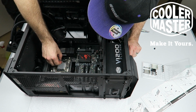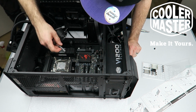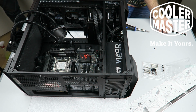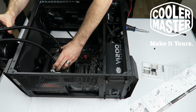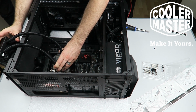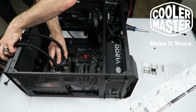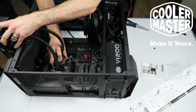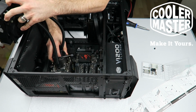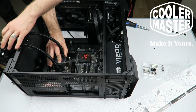And in the end, guys, what you do after you've built a PC, just monitor your temperatures. Just monitor everything. So if it goes wrong, you know, fine. Get it off. Reapply the paste. Yes, it sucks. Yes, I'm gonna have to stop the stream then. But just redo it until it's good. Perfect spread. Like I like my sandwiches in the morning.